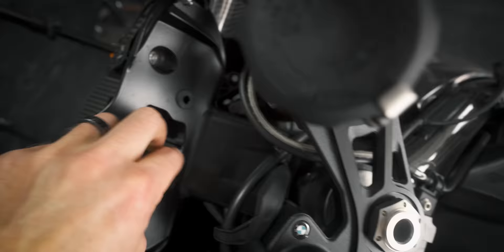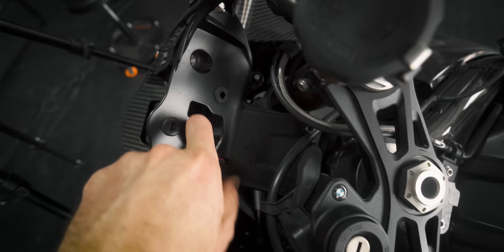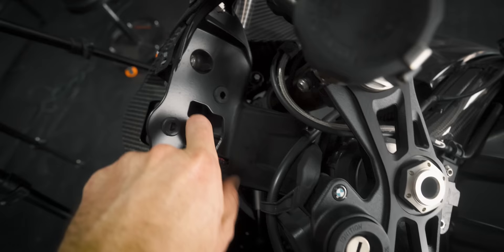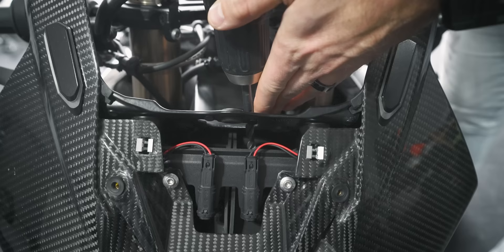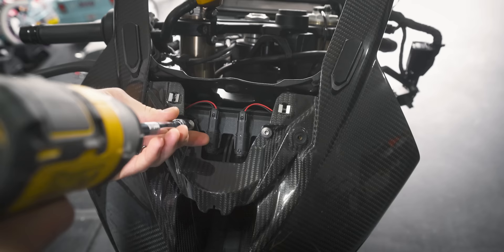Now that I've got the dash off, we're going to be drilling a hole with a 5/16th bit right into the top of the nose right here. This is just plastic and then the sensor can go right in there. After taking a look at where that cable is going to come through, I don't think I'm going to be able to get it through without taking the front nose off — but it's not too difficult. I've done it before when I put the carbon piece on. It's just held on with a few bolts — maybe four — and then we'll have to take off the mirror block-off turn signals, and then it should just slide right off.